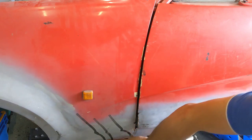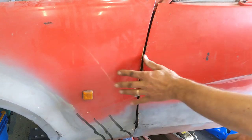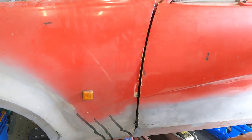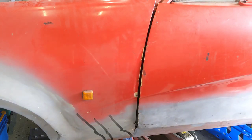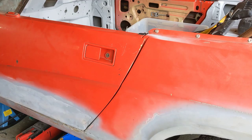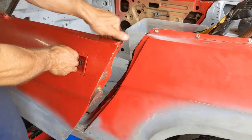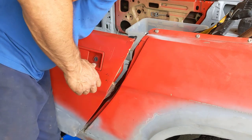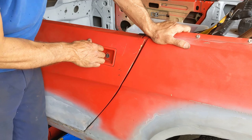I think maybe what I've done is pulled this too tight - it's too flat and needs to come out. So I'm going to take the door off again and make a new shim to get that to fit properly, and also try to loosen these up and see if I can get it to come out just a little bit. I've made a shim out of 18 gauge and the door now goes in exactly down the middle, so I'm going to consider that the door opening and shutting properly and in the right place - just got to work out why it gets so stuck.